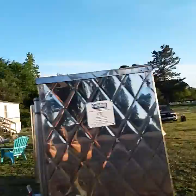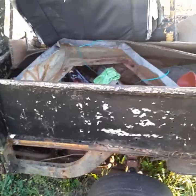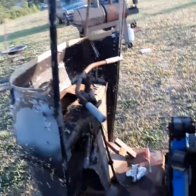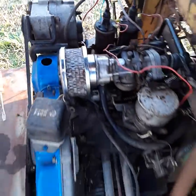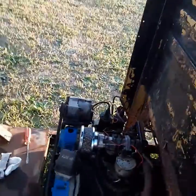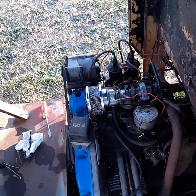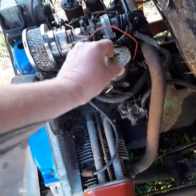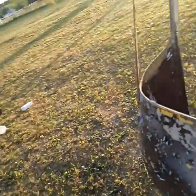Pretty much it with the hot dog cart. Tinkered with the Cushman Truckster — took the back fenders and all off. Yeah, a lot of rust going on. I gotta get the bed off. I kind of hesitate to take the cab off because I'm still using this thing a lot. But it wouldn't crank with me the other day — I checked the points and they're firing, but I think I flooded it because I was trying to crank it a lot faster than I normally do. Normally I don't choke it at all; I just let it finally catch and crank. But I did choke it, and I think I fouled the plugs because it was arcing inside the distributor. I've never really noticed it doing that before, so I'm gonna change the plugs out. I do need to adjust the valves on it — there's a lot of valve train noise going on.